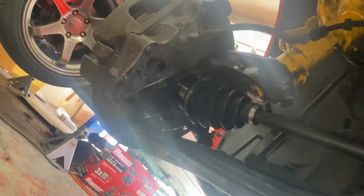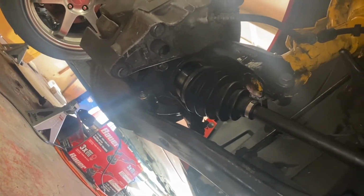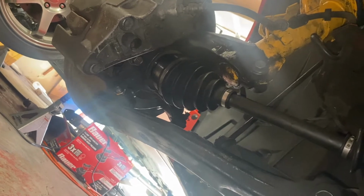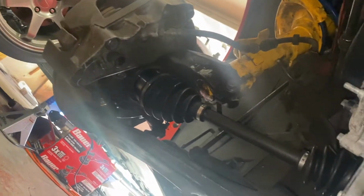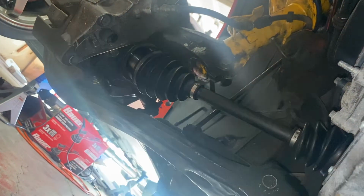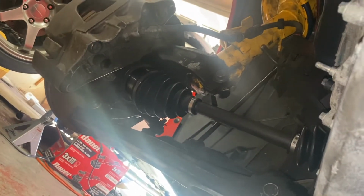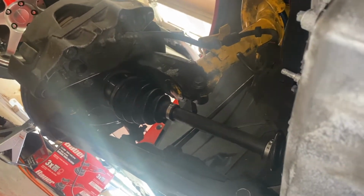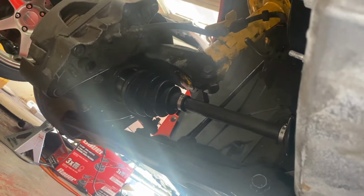And then I got the ball joint nuts and bolts on. Those are 30 to 43 foot-pounds. For a tip on the ball joints there, it's a tapered bolt. So basically put it in. It's not going to feel like it wants to go, but you need to hammer on it until it basically goes through the hole and not to the other side.